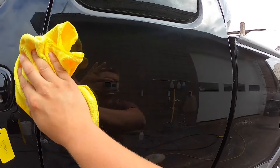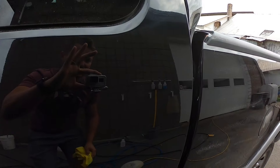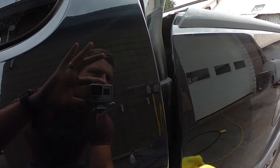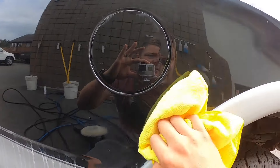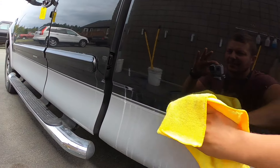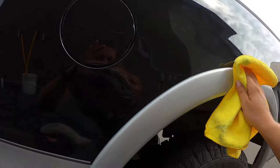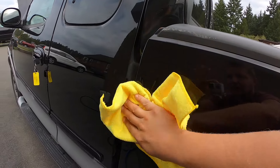Now that we've finished, you can see the scratch is gone completely. The paint looks luscious again — high gloss. You'll notice I used a wool pad. You can also use foam as well, but wool is mostly for cutting. The reason I used the wool pad is because it does the best job the fastest. It's definitely the hardest pad to work with though, because you've got to be really careful not to burn any plastic trim or plastic moldings.